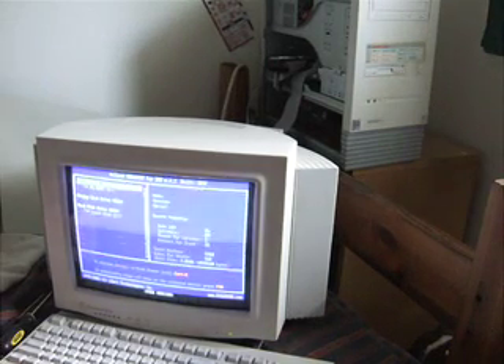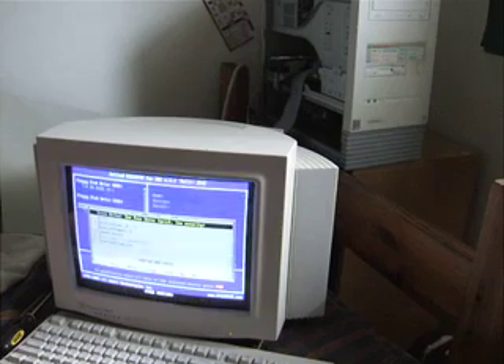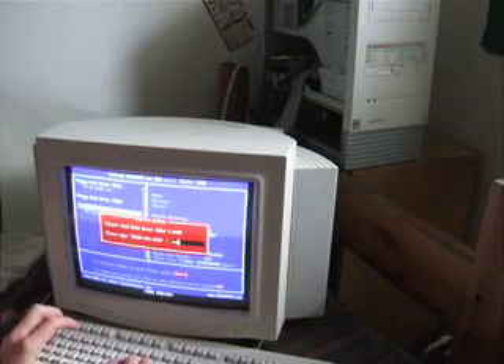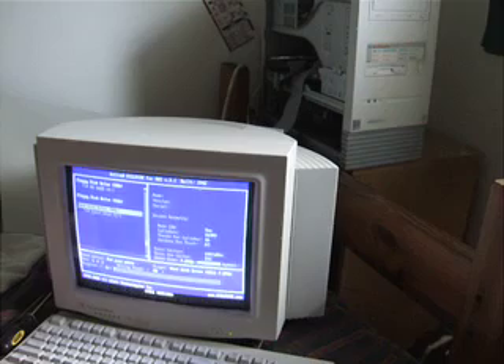There's a little window that pops up saying it only supports one pass zeros in the free version, which is fine. You navigate down to your hard drive — the one connected that you'd like to overwrite. Then it says to permanently erase all data on the selected device, press F10. So you hit F10, one pass zeros, hit F10 again to go. It's going to say 'erase all data' — you have to type that in to confirm. Hit Enter and now it's running, overwriting with one pass of zeros. You can run it multiple times if you're giving your hard drive away and want to make sure it's safe. That's how you run KillDisk, and when it's done the disk will have nothing on it and be ready for use in the Mac G3.